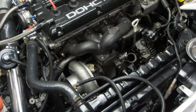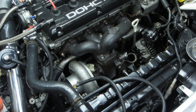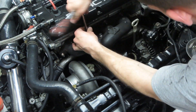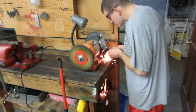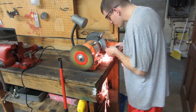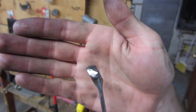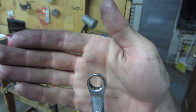When installing the turbocharger, the wrench just barely doesn't fit the right front bolt due to the number one runner. Guess it's time for a special tool — RB1657301. It's not a difficult tool to make: just grind some of the material off the box end of the wrench to give a little more clearance. This is what you end up with — a slightly altered but still usable wrench. Try to leave enough material so the strength of the metal is not diminished to nothing.